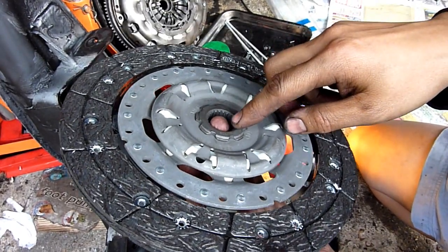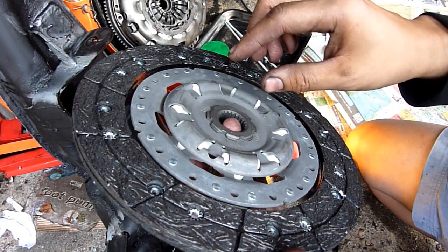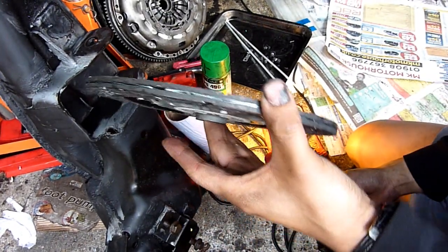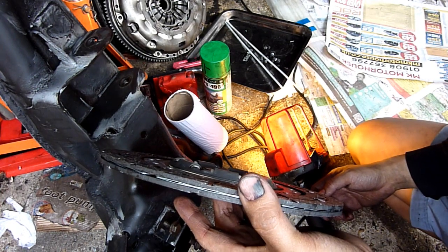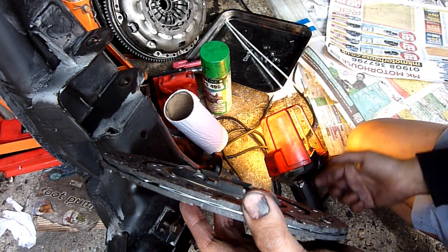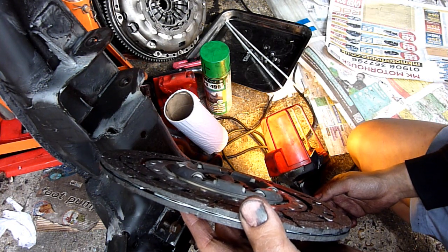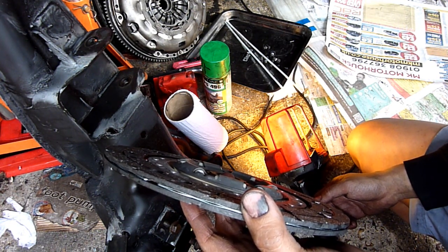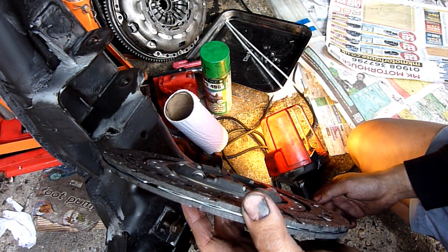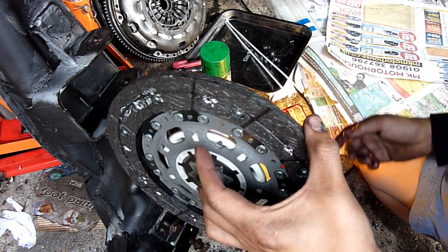What I'm going to do is grease it up — a little bit of grease, and grease the spindle on the transmission end as well, then wipe up excess grease. This LUK clutch kit did not come with a fitting tool and also didn't come with grease. I think I'm going to use the LM grease — it's thicker, and this thing will be spinning. Perhaps a tiny smidgen of anti-seize, tiny, because I don't want it seizing up.